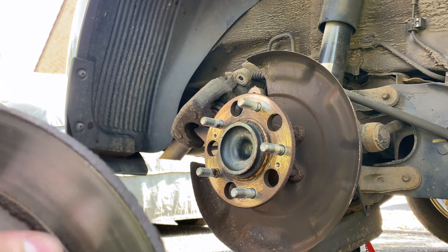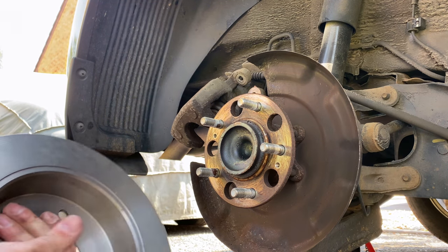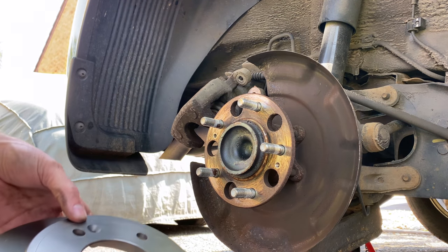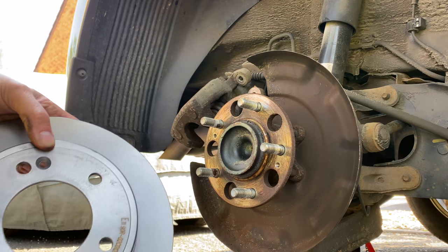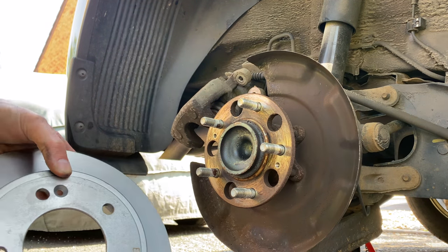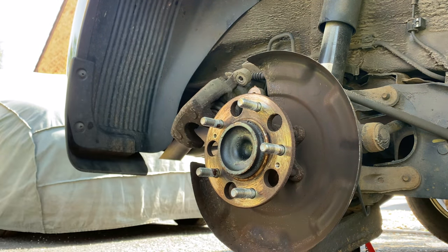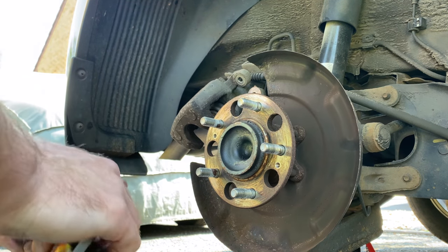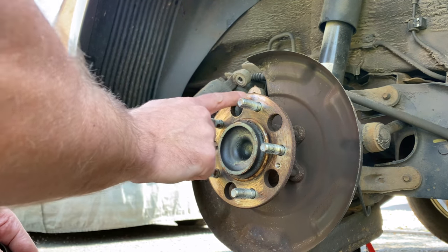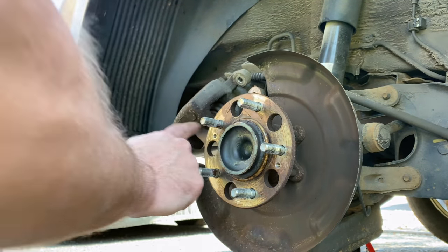Do note that on the parts catalog they have two different sizes of brake discs. These are the smaller ones - I figured this is the base entry car so it's going to have the smaller discs. You can see where your studs go through and where the screw holes are. You could put some copper slip on the back of this - a little bit of this goes a long way, but it just helps stop things corroding and seizing up.